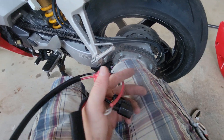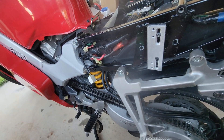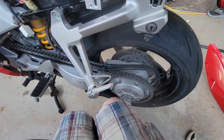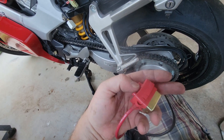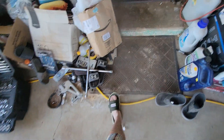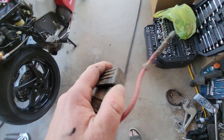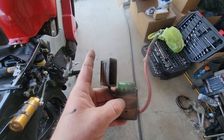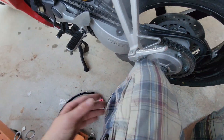He provides crimps, but I'll be soldering these instead — I'm not a big fan of crimping. You just have a positive and a negative for power, going straight to the battery. You don't have to worry about Honda's not-so-great power harness on these bikes. There's an inline fuse, and this one is an auto-resetting fuse — when power drops, it resets itself. He used to include a big traditional fuse holder, but now it's automatic, so you don't need to carry spare fuses.